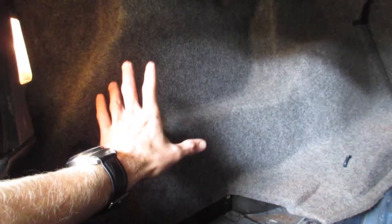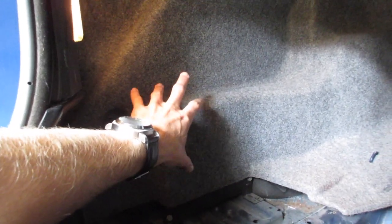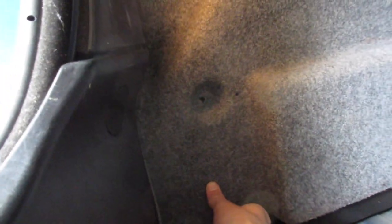Now we're left with the trunk interior. We can see some wires going to the tail lights — that's not what we want. We want to pull the carpeting back to see what lives behind it. In navigation-equipped cars you'll have all kinds of nav computers and probably an FM module back here, different brackets. This is non-nav, so it's going to be a lot easier. There's a hole here — it looks like there might be a clip that's supposed to secure it, but this car doesn't have one.